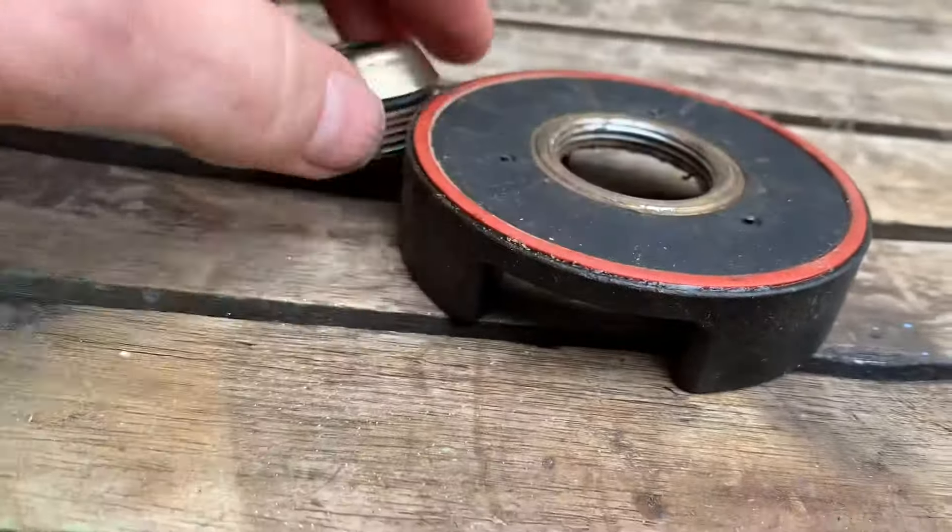I'm just going to finish this video now and show you where you can get the bearings from. Don't throw away your old bearing because you're going to use it to bash in the new bearings. There's a huge range of these — if you type 'skateboard bearings' into eBay you'll see a ton of them. You can get 16 of them for £5.19, so if you've got skateboards or kids' Heelies to fix you can use the spares. Obviously if you're a commercial operation with lots of Vitamixes, you can keep a whole load of spare bearings on hand.